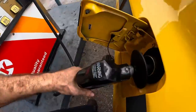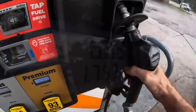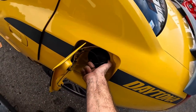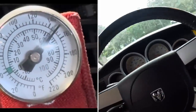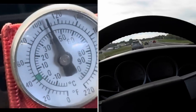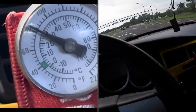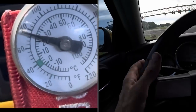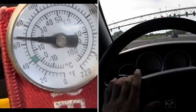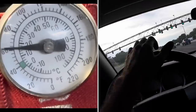No, I don't want to save money by giving my phone number. Fueled up, let's get out of here. Cap clicks — alright. It still barely has any gas but we're going. Going over the bridge at about 55-60 miles per hour, looking at the vent. I'm seeing about 52 degrees at the center vent. Phenomenally much cooler than when we started. We started at about 80 degrees, did the TXV and ended up at 70 degrees, and now we're at 52 and some change. That's good enough for me.